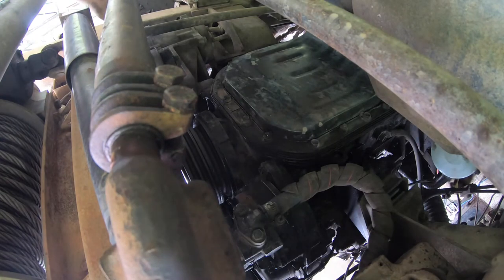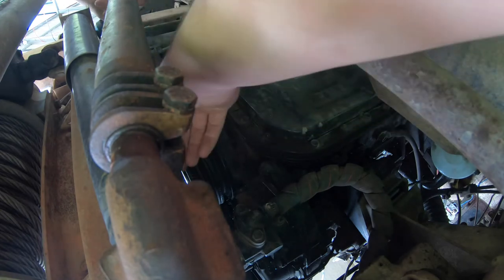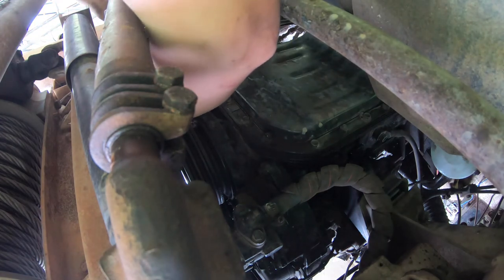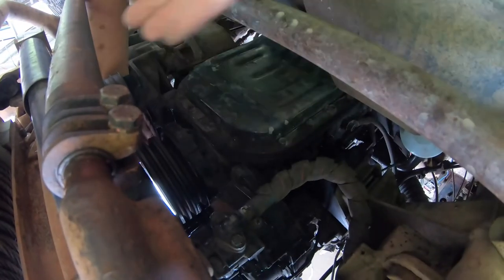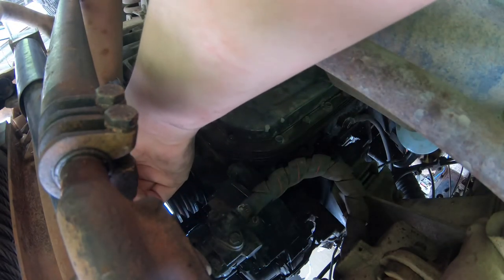Underneath, I fish around to find that belt and pull it past the plastic air cowl, just like the other belts. This is the bit where you really need two people or really long arms. I let the engine cool off first or this would be even more challenging. Now getting dirt in my eyes and can't see what I'm doing — working by feel. The jockey pulley is in the way and I wish I had my pry bar.